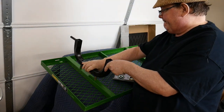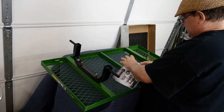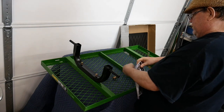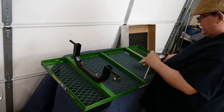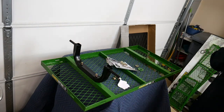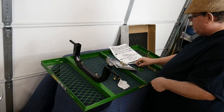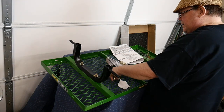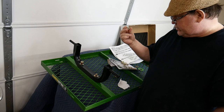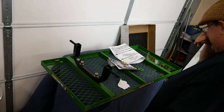All the primary bolts are in place. We just set the rear axle into place and pull out the two washers and bolts that are required to hold that down. The bolts being provided are very top quality aviation-style bolts with nylon locks built into them so that they stay tight once tightened down. We're on step one and we're going to put a washer and a bolt on each of the two points for the rear axle. Right now I'm just hand tightening them — you can see a close-up of the nylon lock washer built into those bolts.